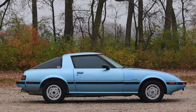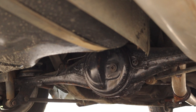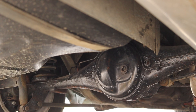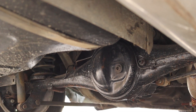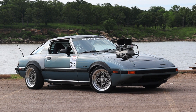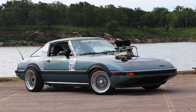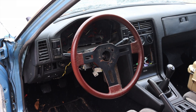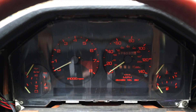Last but not least, this is rear-wheel drive — all RX7s are rear-wheel drive. This first gen actually has a solid rear axle, where the second and third gens had independent rear suspension. It's really really solid and stout. I actually drove a first-gen RX7 with an LS swapped into it with the stock rear end, and it held up to a V8, so it can definitely hold up to the rotary.